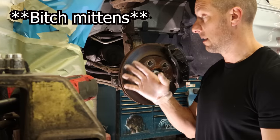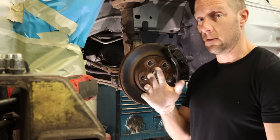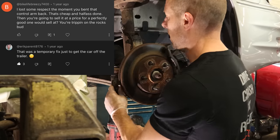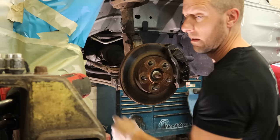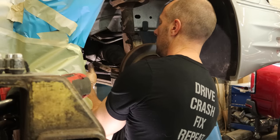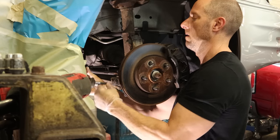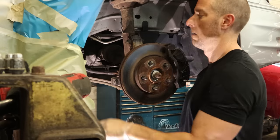Before you give me a hard time about my gloves — there's a lot of drive axle grease all over the place and I don't want to make a mess out of my hands. Besides, I just got off my shift at Subway. YouTube doesn't pay as good as you guys think it does. So we're going to change our tie rod ends — got to film it or you guys will accuse me of just straightening it out and sending it down the road. Unbolt our tie rod end and tap it out of the knuckle. We'll put the nut back on a little bit first — we need to break our jam nut loose, and it's a lot easier to do when it's held up on one side. Once we broke it loose we can pull the nut back off and spin our tie rod end off. We'll count the turns even though it isn't going to matter because we're changing both the inner and outer tie rod end. That's the alignment guy's job anyway.